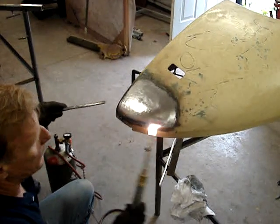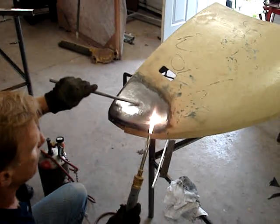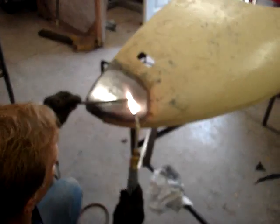You're going to want to play the heat on this panel and bring it up to where it stays shiny. But you also want to soften your solder as you go. I'm going to start following my torch tip around and watching my solder end.